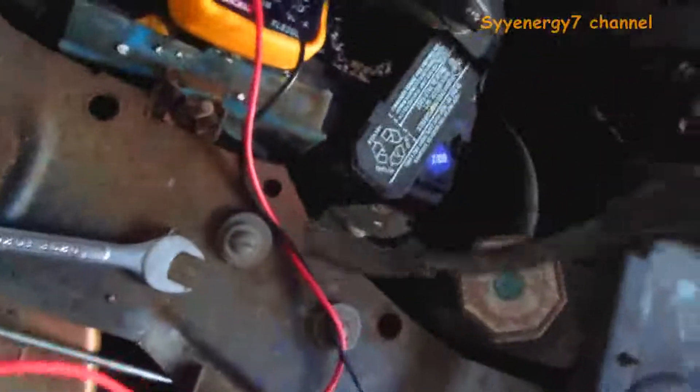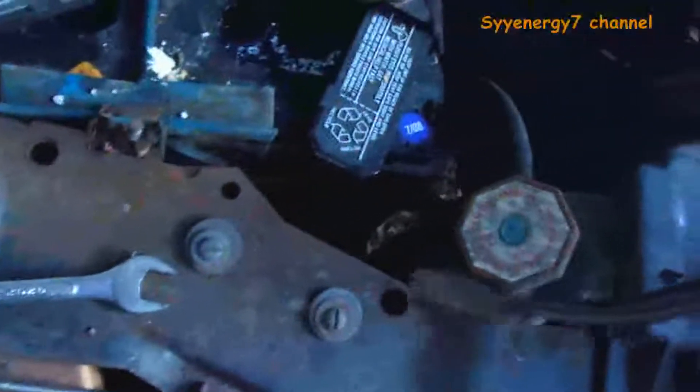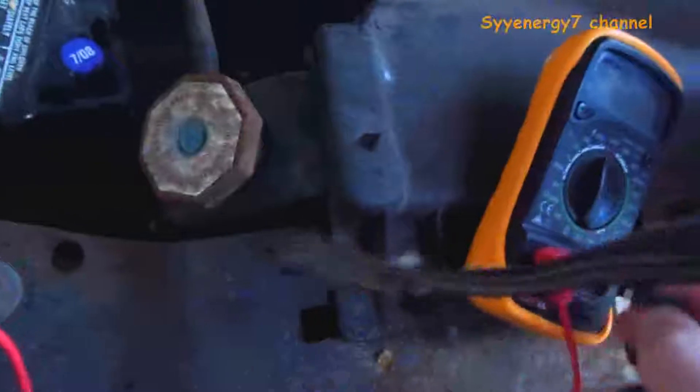There you go — it's drawing like, I don't know, probably about five amps. So the headlights should have been drawing more than five amps, but it's a low battery. It's just not totally messed up in the sense of excessive parasitic draw, but the battery is low.